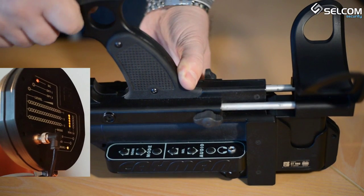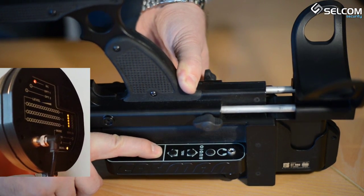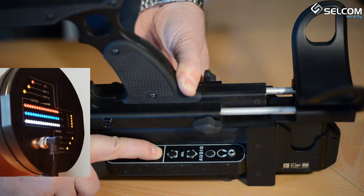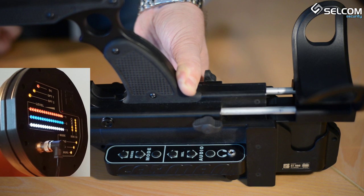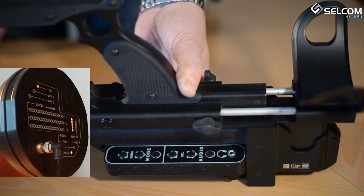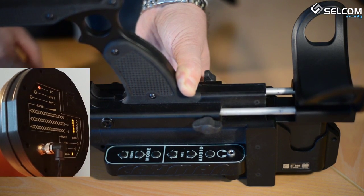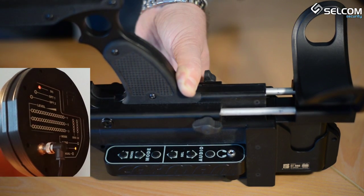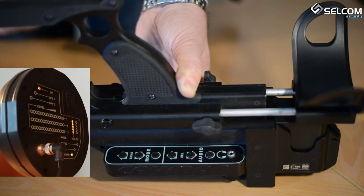The adaptive mode is enabled by pressing and holding for 3 seconds the mode button. The adaptation takes 10 to 15 seconds, with only the SENS indicator lit on the antenna module during that time. The SENS indicator will show a consecutive lighting of segments, allowing the user to check if any indicator segments are dead. Switching from automatic to manual mode is done by pressing the same button.